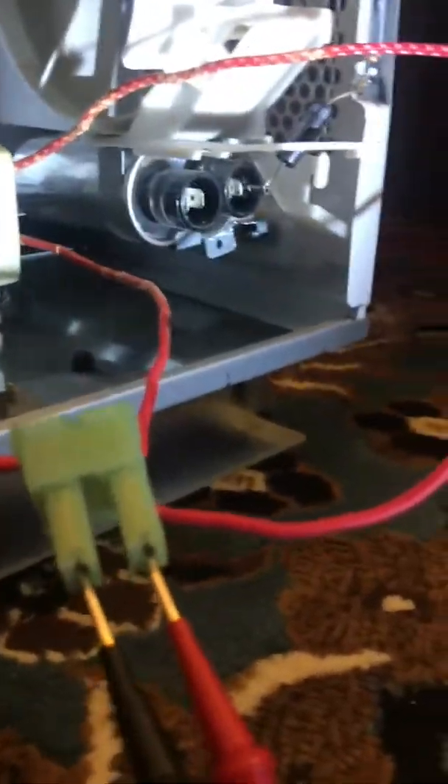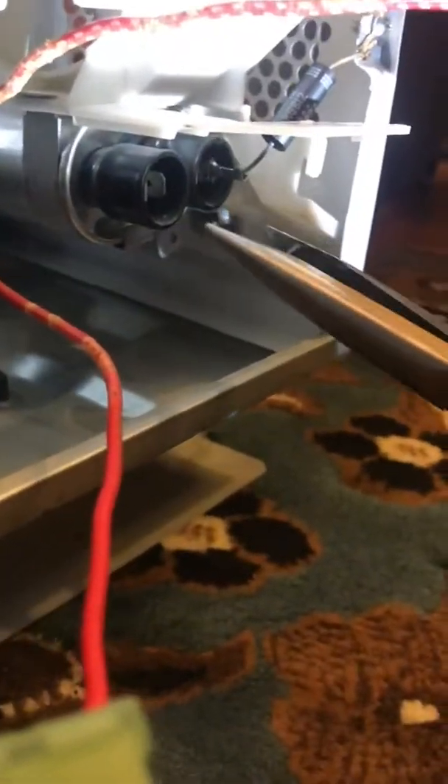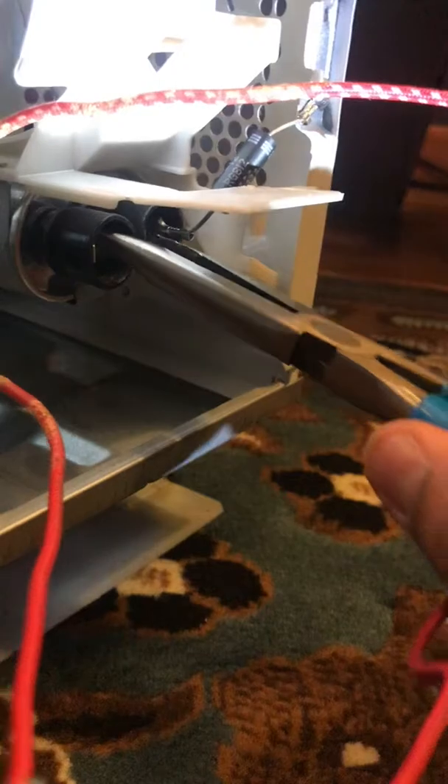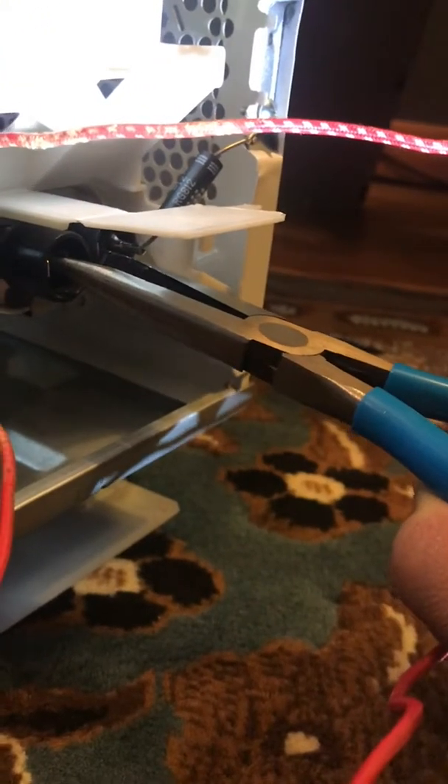You've probably heard that you want to discharge this capacitor. You can do so by taking a needle nose pliers like this and touching the two terminals on each side together with an insulated pliers like this. Be very careful — it can be dangerous.